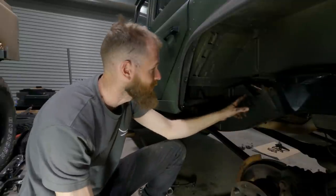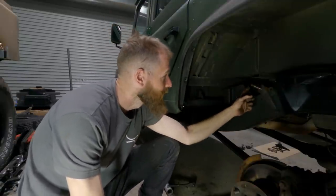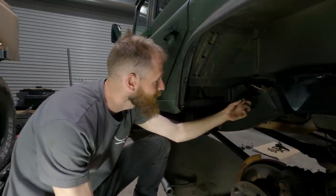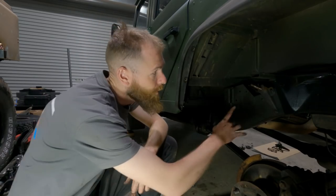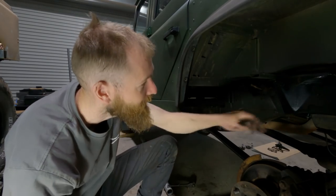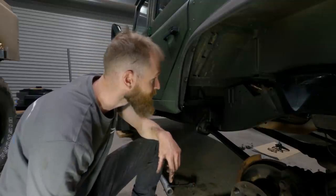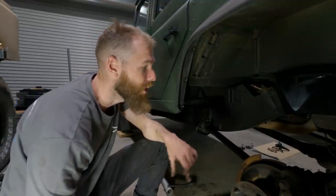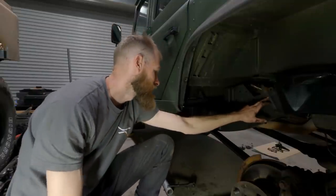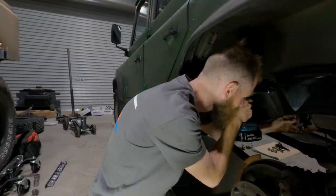The rear shocks, I'm going from an eye mount to a pin-to-pin mount, so the factory brackets have to come off. And they're just covered in grease. I've also just noted a bit of paint peeling off under here, a bit of corrosion, so I've just hit that with a wire brush and a lick of paint. So we are just waiting for that to dry before the spring can go back in. But I can take this off and then look at probably fitting up the shock.